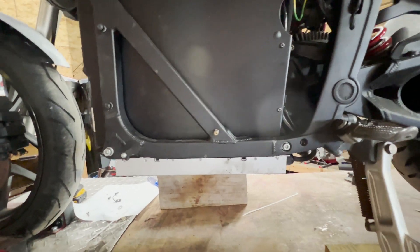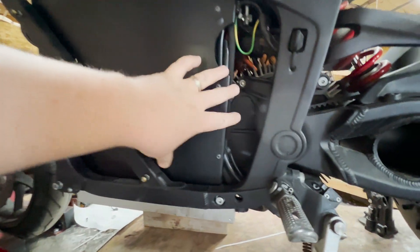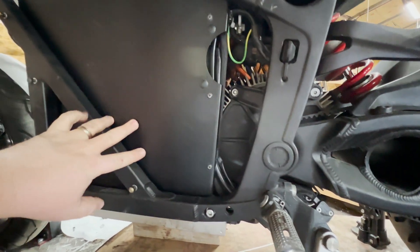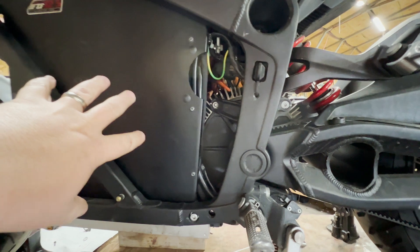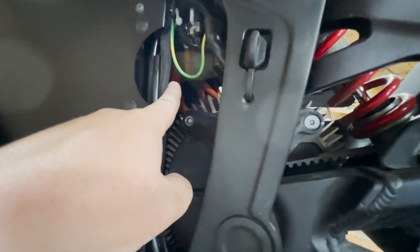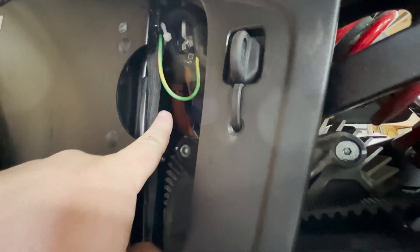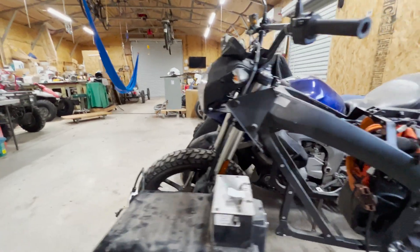Now comes the fun bit. You need to jiggle the battery forward and you can actually move it just a little bit. You can move the bike around or move the battery itself, but you've got to wiggle it. You've got to get up there to that connector — the connector that's hiding way right up inside there. Let me zoom over to the one I took apart and show you how that works.